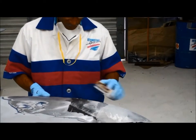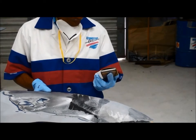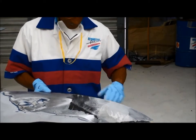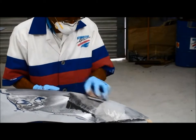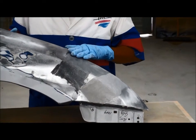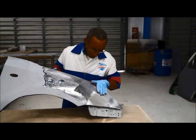Because this filler is very much more textured because of the carbon fibers, I will use the 80 grit paper just to take the top off and begin to level it. Then I will go through with the 100, 180, and 240. To the right is a Multi-Carb which has been sanded from 80 right down to 240 with a fine feather edge.